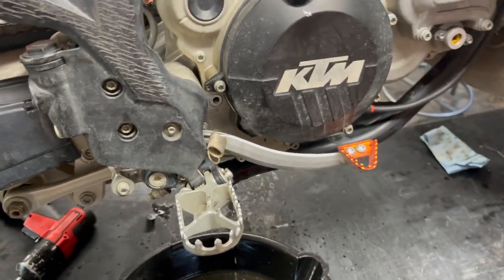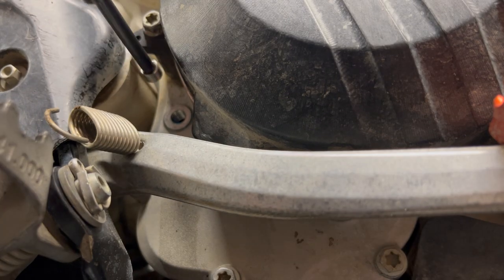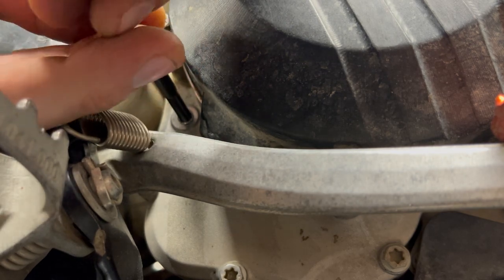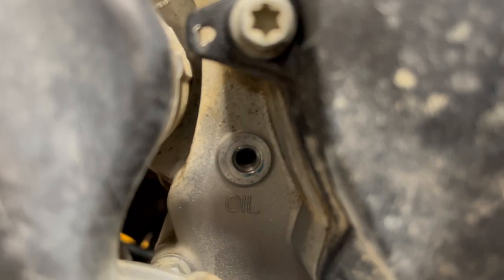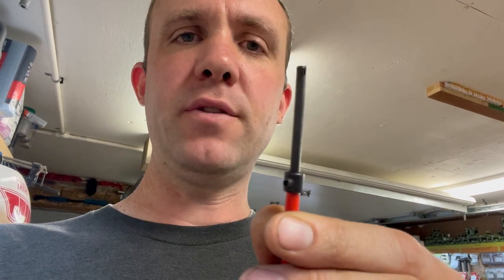Now I've leaned it over that way - some brake clean around that hole. The Helicoil can go on the little installation tool and I'm going to put a little bit of Loctite in the hole. Basically I put some Loctite in the hole and I run it in until the Helicoil is just a little bit in from flush, because I want that copper washer to sit nicely against the case and seal that up. Now this is the most important and most critical part - this little tool is designed to break the little tab off the end of the Helicoil, and if you drop that into the motor you've got to pull the clutch cover off.